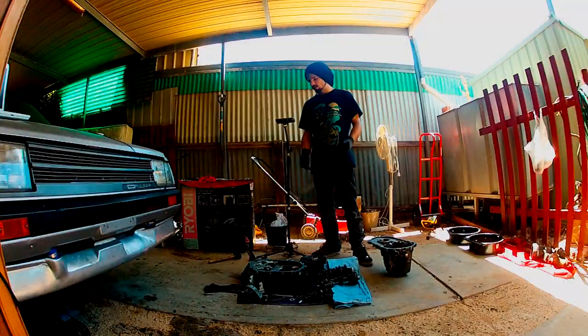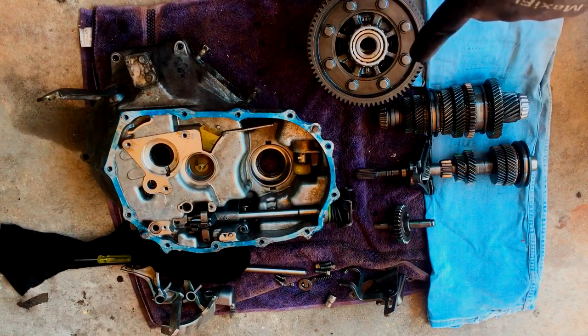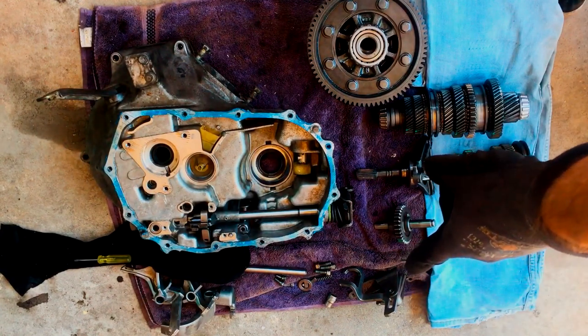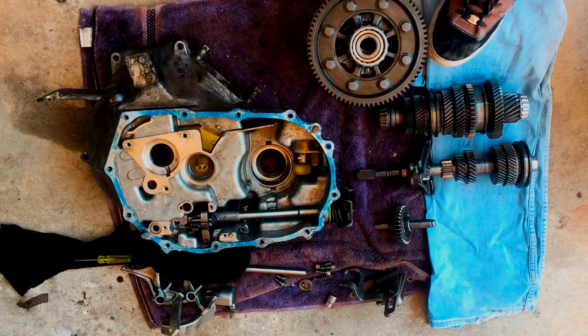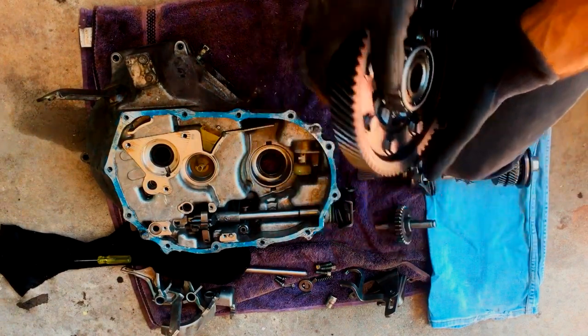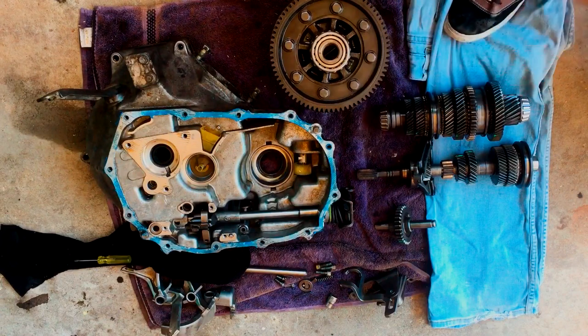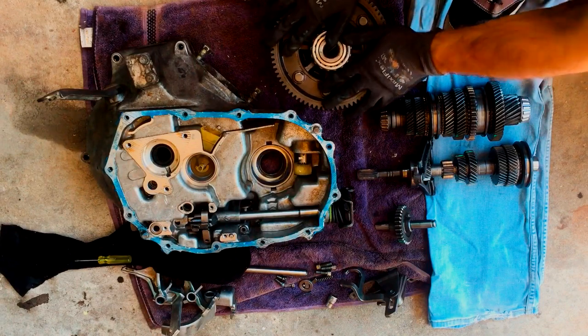Here's what happens: when you get your N13 gearbox and take everything out the same as we've done with the N12 box, you get the N13 diff and N13 crown wheel, the N13 output shaft, N13 input shaft, and N13 reverse gear. We're going to use the N12 selectors and N12 forks - you can use the N13 forks as they're pretty much identical. Now, you take the diff with the crown wheel attached and put it in the box, and you'll notice it doesn't spin around very well. So what needs to happen is: take the crown wheel off both diffs, use the N12 diff with the N13 crown wheel. Take the crown wheel off the N13 and put it on the N12 diff, and when you put it in it'll spin nicely.